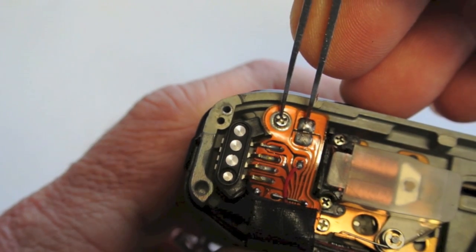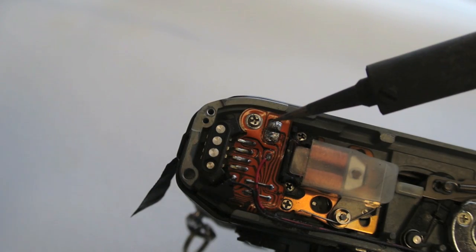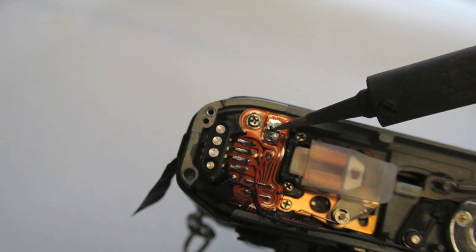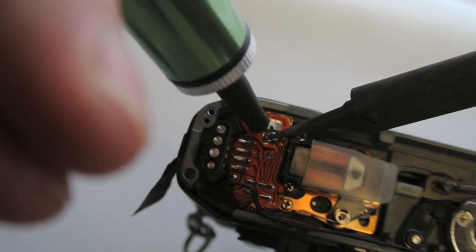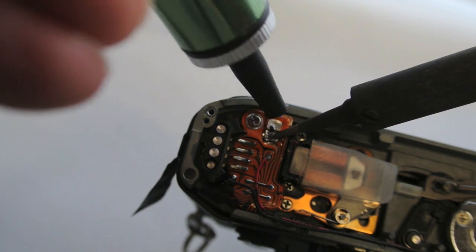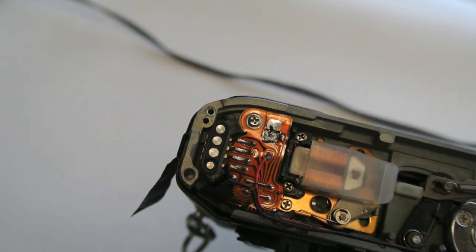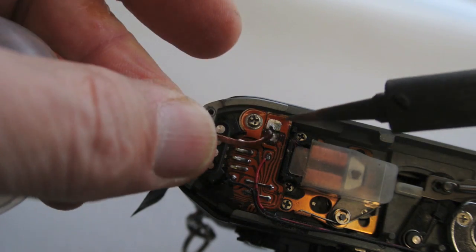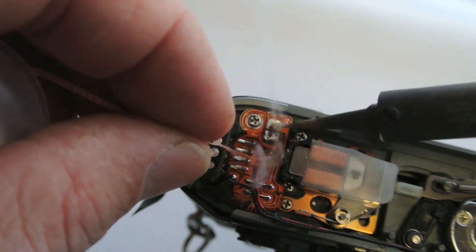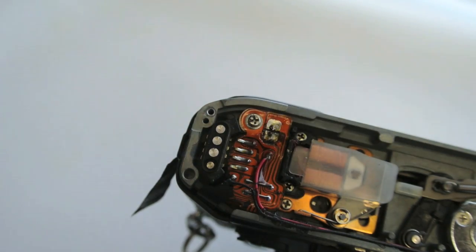Be certain that a good battery is in the camera and test the magnet again. If it still does not release, then the magnet will need to be replaced. Remove the battery and desolder the two magnet contacts using a desoldering pump — heat the solder with the iron and then place the pump over the molten solder. Work in quick steps so the underlying plastic is not melted. Any remaining solder can be removed with desoldering wick: dip the tip of the wick in flux, place the soldering iron tip over the wick onto the contact, and rub. The molten solder will draw up into the braiding of the wick. Work quickly.